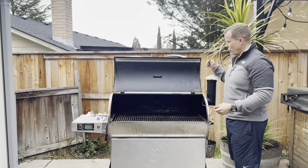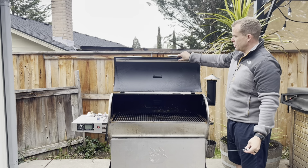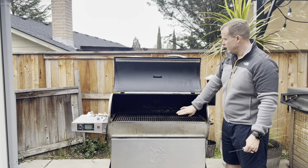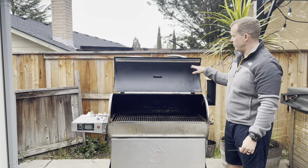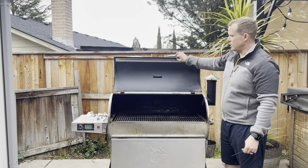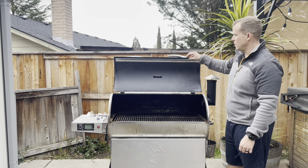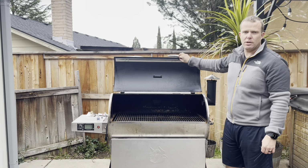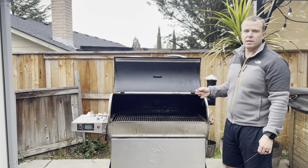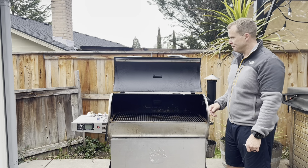And then finally, once that is all done, your cure time is up. We do recommend, because it is possible during the cooking process that this stainless steel drip edge could come into contact with your food, the RTV is food contact safe. 304 stainless is generally a sterile product, but during the manufacturing process, it's of course possible that some residual manufacturing oils could be present on this. So like most good things, we do recommend that you do a 1 hour burn time at 400 degrees. Again, just to make sure if there's any residual manufacturing oils that we burn those off and those don't come into contact with your food.